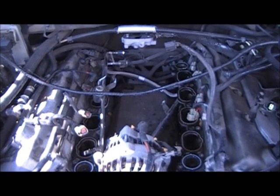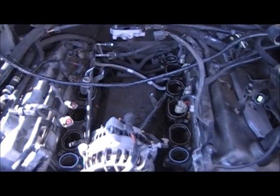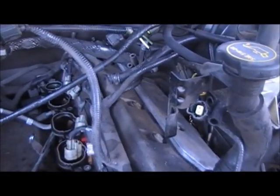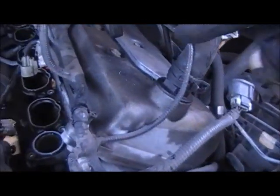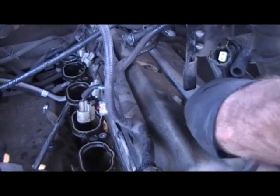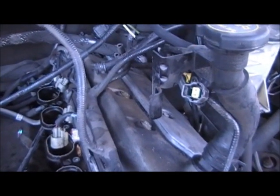There we are with the intake out — a relatively easy job. Now, the left bank cylinder head is the driver's side cylinder head, cylinder eight all the way at the rear. We're going to start by taking off the valve cover on this side — it's attached on the outside edges as well as through the middle bolts. But first we want to take off this cover in the middle, which is covering our coil packs and the valley ways down to our plugs.